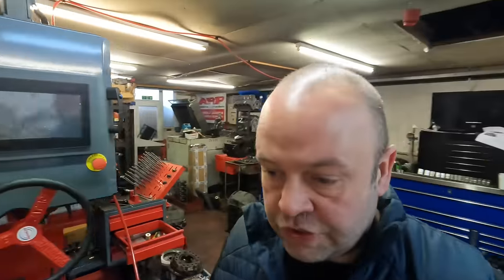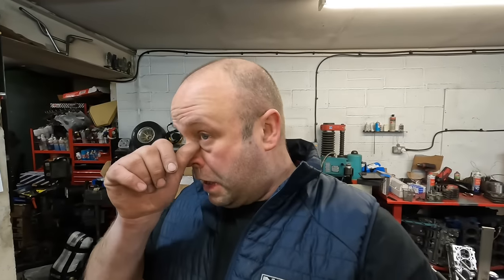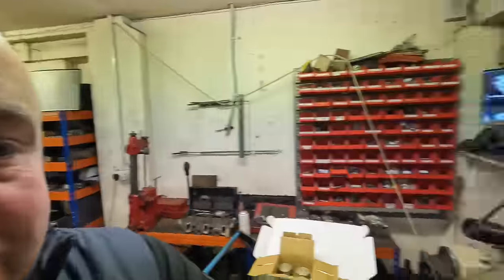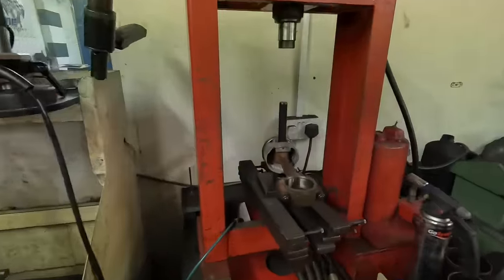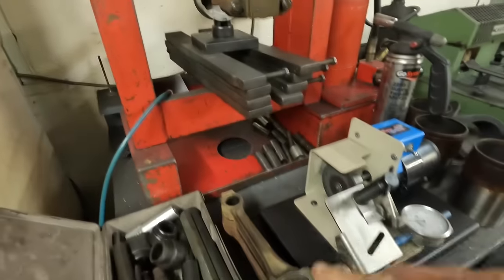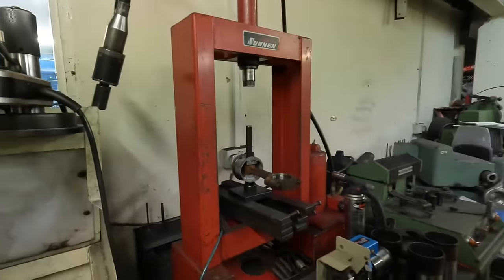The other thing that I've done on this engine, which I'll show you now, is the replacement pistons and rods which come out of that engine, because the other engine, where it had swarf in the engine and the engine had been rotating, the swarf had been hitting the side of the rod and had damaged all four rods quite bad, so we decided not to run them. So on the replacement rods out of the replacement engine, at the moment I'm going to recondition them. So I've removed three of the pistons. This is number four.